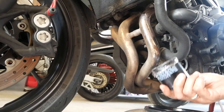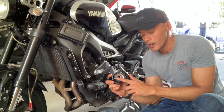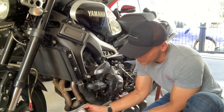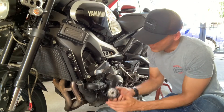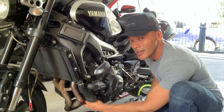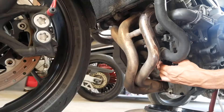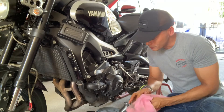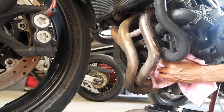Now I'm going to bust out my new oil filter. These seals are dry at the moment — you need to use a little bit of the old oil to lubricate the O-ring. Get some on the O-ring and spin it on. Whenever you're threading something, try turning it counter-clockwise at least for one turn so you get a good seat on the threads and don't get it cross-threaded. Hand tight is fine — we don't need to crank it down. It will actually tighten up with use.